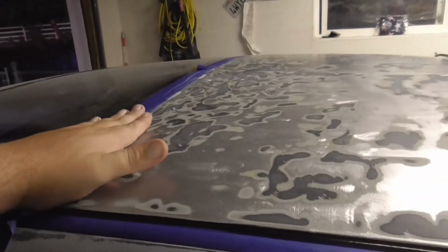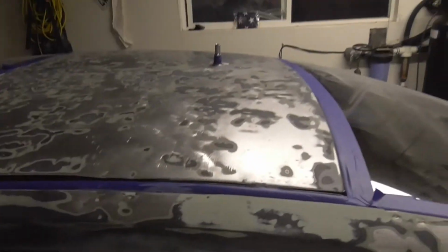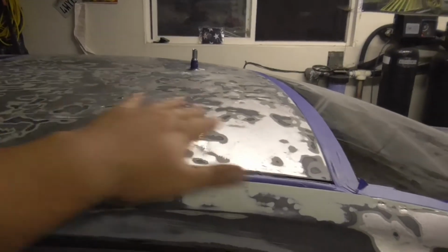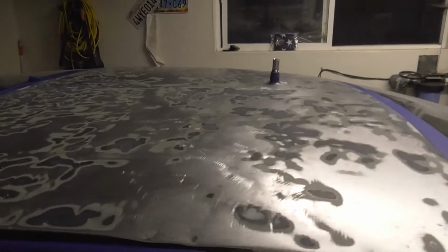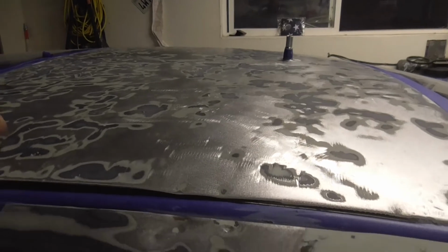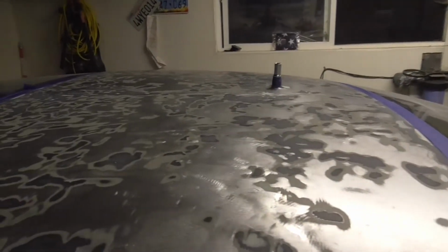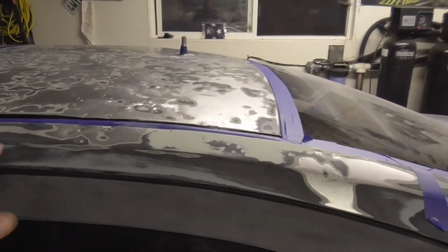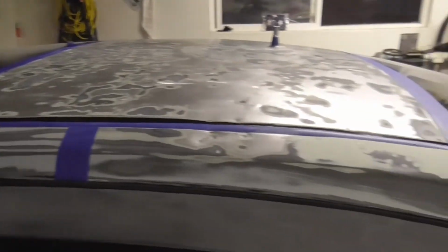So that's where I can apply my DuraBlock sanding block and have that flat surface where the existing roof already is, versus building up some eighth of an inch thing of bondo and then sanding it flat and leaving it that way. These guys that did this before me did a quarter inch, and that's why it pilled and cracked and messed up. So anyway, let me figure out how I'm going to do this. I'm going to have someone else film me, and we'll be good to go.